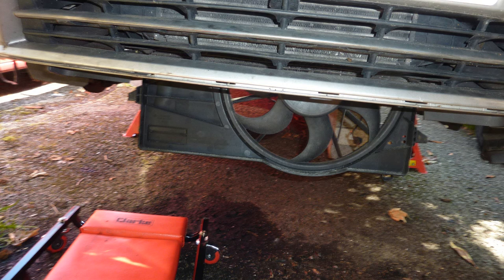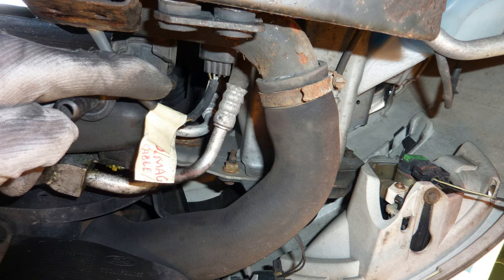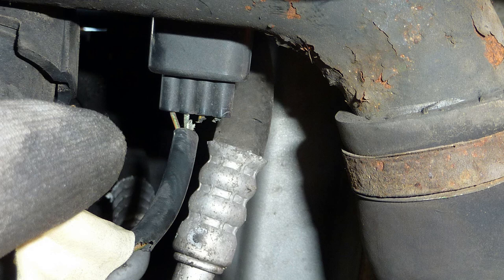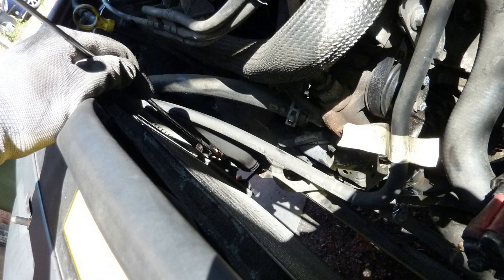I'm dropping the radiator here, so the radiator is best dropped down. Notice my car is jacked up on the slope. It's this one, see it? See the two right cables on that four cable connector. Look, I'm pointing, making a big point of it. That was causing the car to smoke like hell. Different combinations of them breaking: the first one breaking, your car kangaroos. Two of them on the right hand side breaking, and you will smoke like hell.